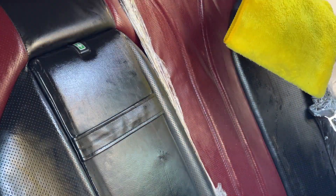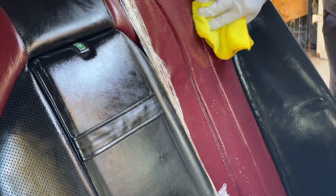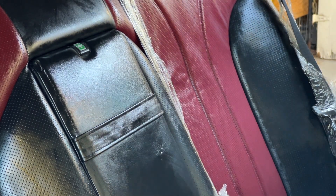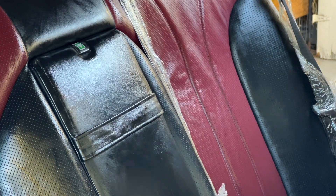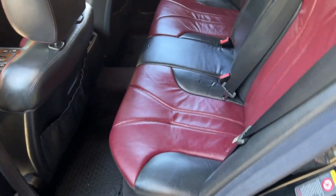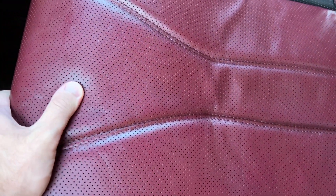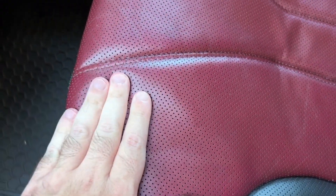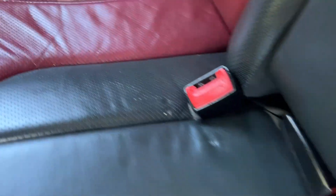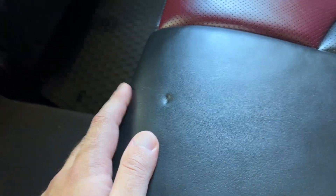Be really gentle if you have dyed leather like this. I noticed when going a little aggressively, I was able to pull off just a tiny bit of dye. In the black sections it works just fine. After the final wipe — wet wipe down followed by dry wipe down — the leather is now nice and soft. The leather in the back was actually in pretty good shape, but it is a lot softer. The spots where a child seat was placed are starting to look a lot better, and that little dimple looks much better in person too.